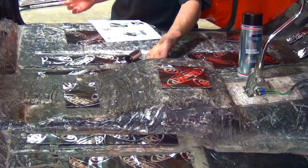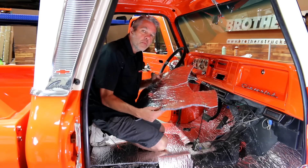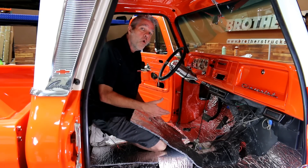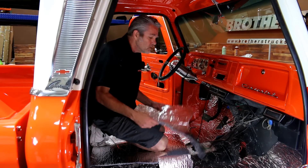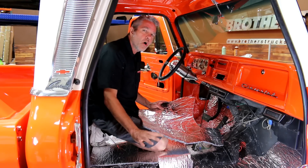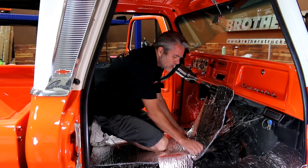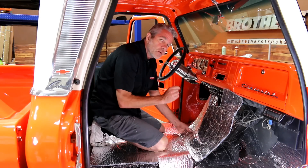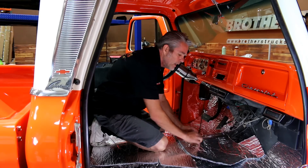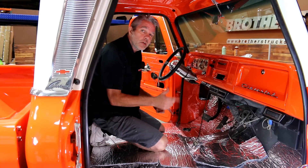If you don't have a roller, just grab yourself a socket and use that. Here's our insulated padding — this is going to keep our cab comfortable all year round. If you're living where it's cold, it's going to keep you warm; if you're living where it's warm, it's going to help keep you cool. When I lay this down I'm going to get it all laid out where I like it. For something like a shifter, I'll place it up, get my approximate hole, and cut it out large enough to test and make sure I'm in the right spot before I enlarge the hole.